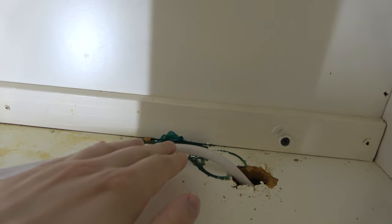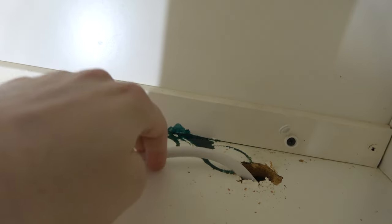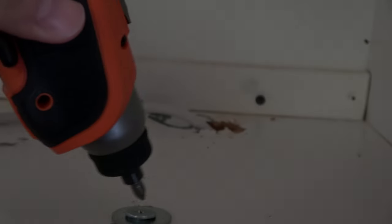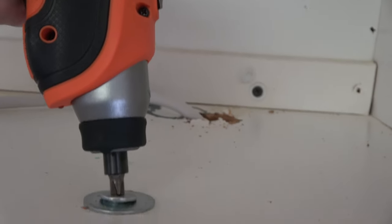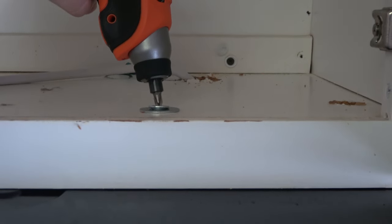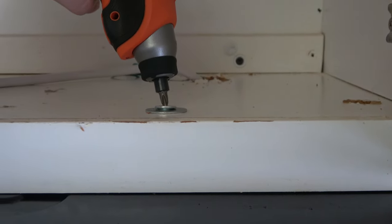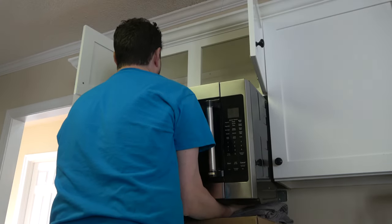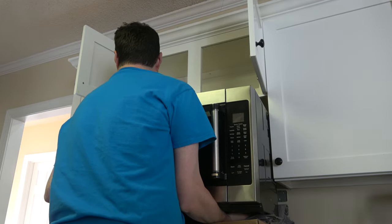You might want to assess how many holes are already in place and consider some patching and painting. Check for stripped screws — loosen only a little bit first. If the screws move, you can use the power drill, but don't immediately use it at maximum torque and strip your screws. Hold the microwave from below, fully loosen all the screws, then lift from the back and rest it down in a safe place you've already identified.